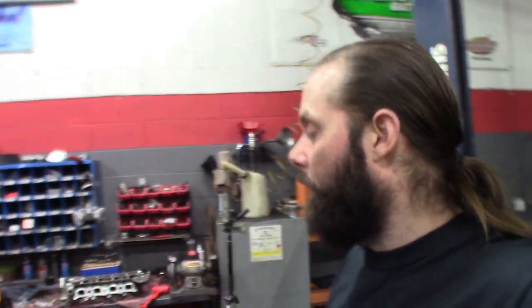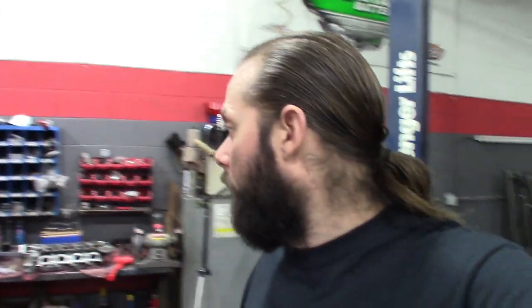So I'm gonna go ahead and knock out the rest of these valves, at least the exhaust sides, then cut out of here. Next time you guys see this head, I'll have all the valves in there, have all the seats in there. I'll kick another video off after I get all the valves in there, before we go bolting down the cams. Maybe we'll do a quick video on torquing those cams down and all that stuff, getting that ready to be bolted onto the block and get this chain on there.